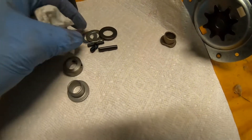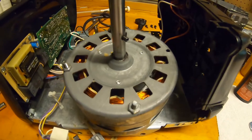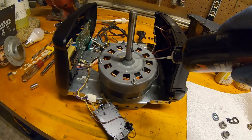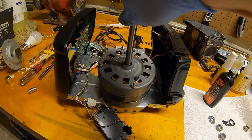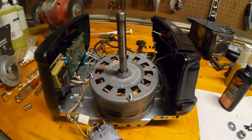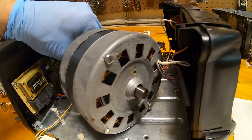This kit actually came with a lot of the parts I was saving, like that collar, the set screw, and all that — so they give you new parts. I'm going to take a minute and lubricate the motor. I like to use this Tri-Flow lubricant — I find it works pretty well on motors. The motor shaft spins very freely, but while it's apart it's a lot easier to lubricate now than when it's back together. It's not a ball bearing — just some bronze bushing or oil-lite. I'll let that oil soak in, and don't forget that back bearing too. This thing is buttery smooth now.